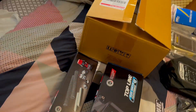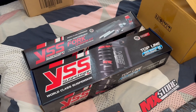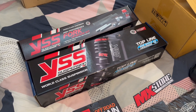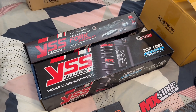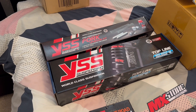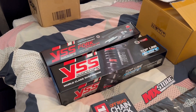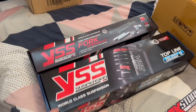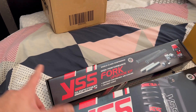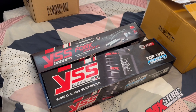This first item was on the bottom of my list — I wasn't sure if I wanted to get it straight away because it's a decent expense. But seeing Curtis's video and real-life testing, and from a safety point of view — not bottoming through the shock as an amateur hitting a pothole — I went with the YSS shock kit. They have a kit on their website for the KLR650. The rear shock was $695 with a 5% discount from On The Back Wheel, and the front fork kit was $450, so around $1,100 Aussie dollars total. Purchased yesterday, came overnight from Melbourne. The install is simple — take your top cap off and everything gets done from the top.